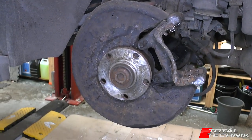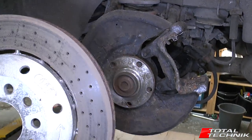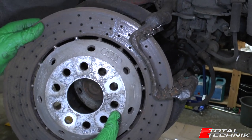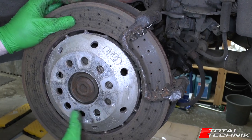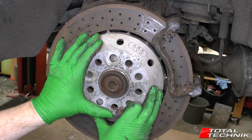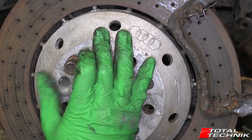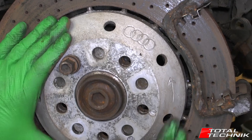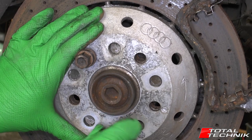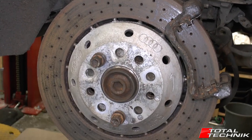The brake disc is ready — we're refitting this one, but yours will be a nice shiny brand new one. I've also got my wheel bolt to hand. Very carefully, fit the new disc around the carrier and get it onto the hub, get it aligned, and put your wheel bolt back in to hold it in situ. I'm going to put the second one in at this stage as well — there we go, that's now safe.